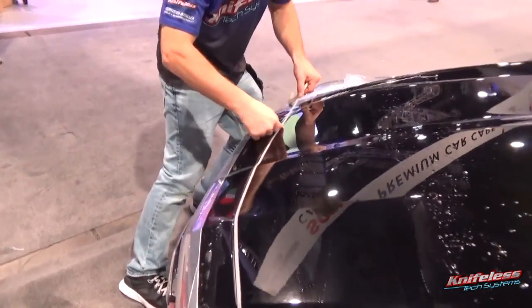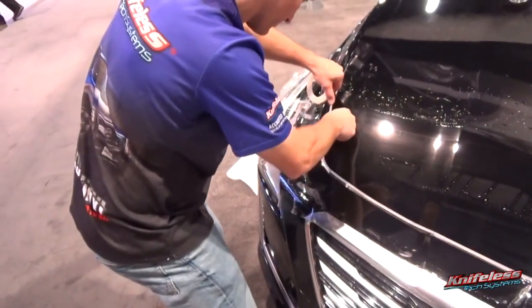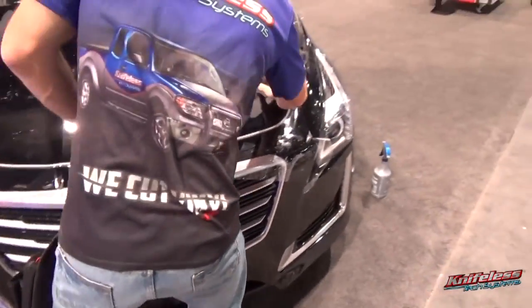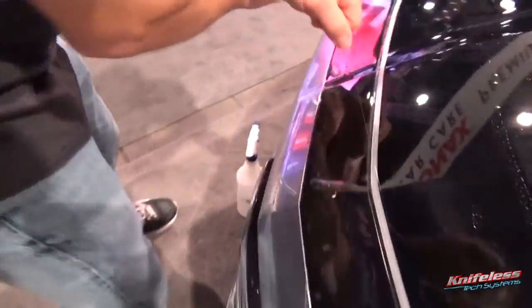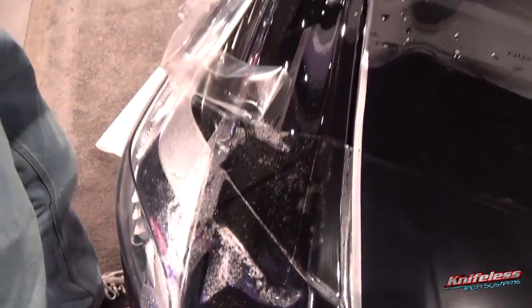But again, this is just going over the tape. This doesn't have to be perfectly symmetrical, it just has to cover the wire. So again, a little less pressure here in applying the tape, but again, you really want to make sure that you're applying it dry, otherwise it won't stick properly. So then once he gets to that point there, he comes back to the other side, and again, simply releases the string. Just pulls, it goes right through, super clean. Again, try to keep it flat, pull in one fluid movement, keep it perpendicular to the line.